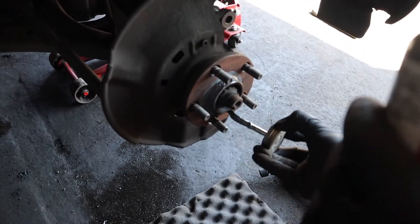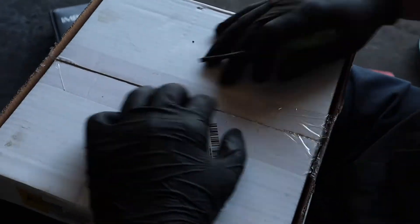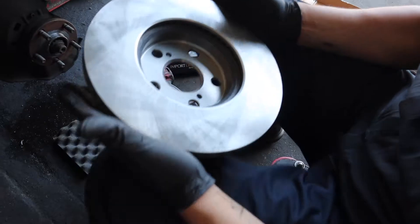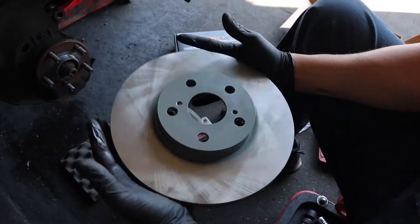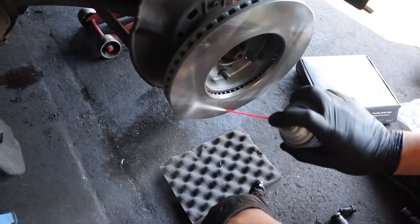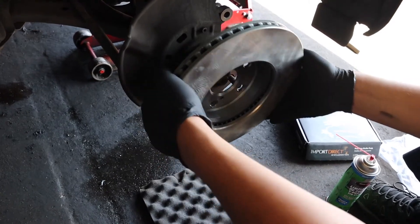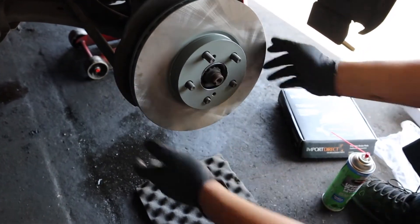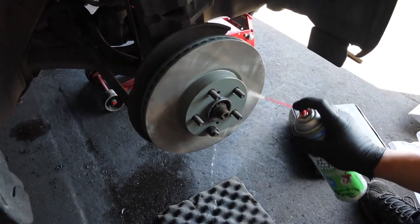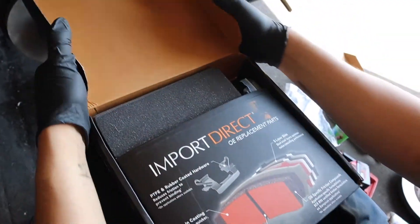Get some anti-seize and go around where the new rotor is gonna sit. Open these up fresh. Then what you want to do is admire them for a bit, and then put them this way so you can clean off the residue — that glue or whatever they put on the rotor to keep it from rusting. Let it dry out, flip it around, and clean the other side. I like to put a bolt there so it stays still.